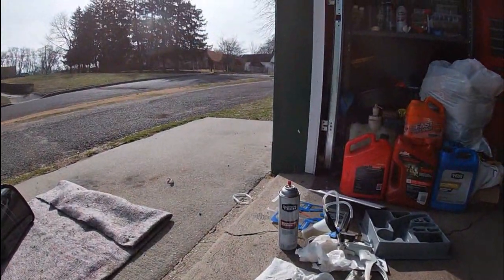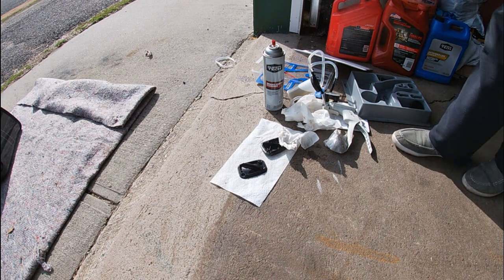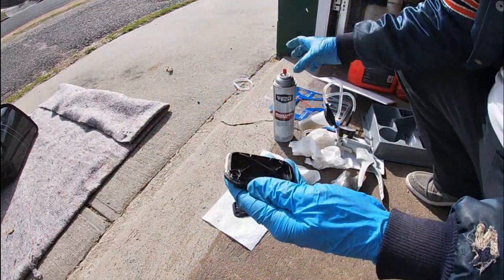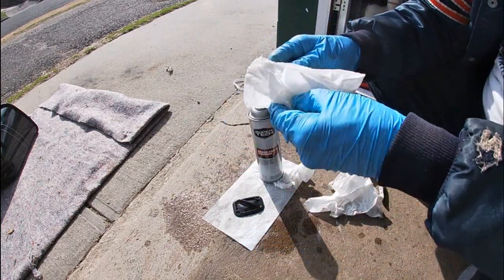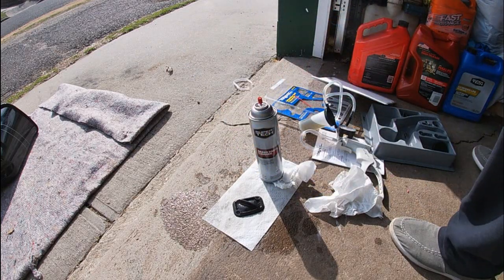Now we move over to the master cylinder side. You can see the corrosion on that cover — I'll bring you back up and show you. We're going to figure out which wrench size is needed. I think it's a quarter but I can't find a quarter inch wrench. Too late now — the cover's on, we're going to leave it as is. Look at that corrosion. So I'm going to hit that with a wire brush, break-clean it, and I'm probably going to end up having to order a new lid. For right now I just have to go back together as it is. We'll throw that brand new diaphragm on.